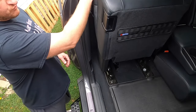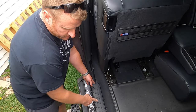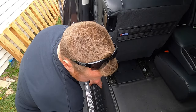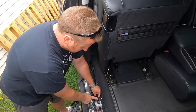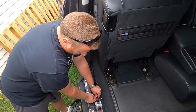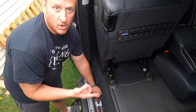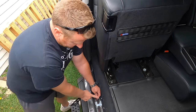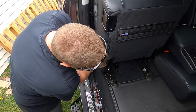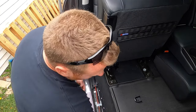To access the wiring for the rear sliding window, you can access the wiring underneath this panel right here, but the problem is you have nowhere to mount the auto lock module. Inside the wire loom the bigger green and bigger red wire are the rear window wiring. Down at the bottom of the seatbelt there's a little cover — pop that cover off and there's a 14 millimeter bolt holding the seatbelt in, so go ahead and remove that.